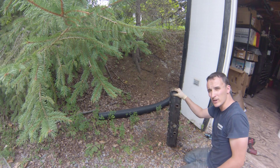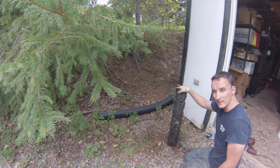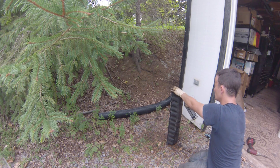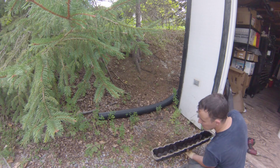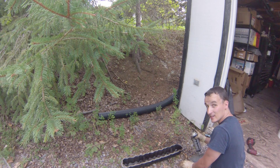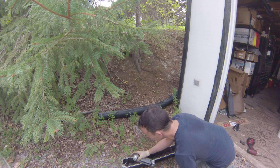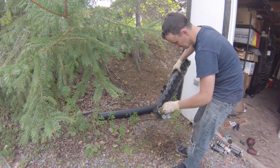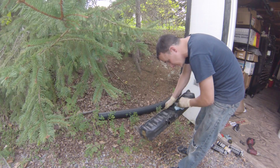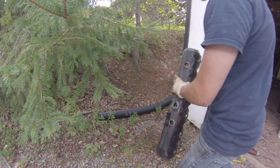Shell's Jeep definitely had some positive crankcase pressure. You can see that the air filter is getting kind of oily — the old one was real bad. These breathers are all clogged up, so I want to make sure I can spray them out real nice. I'm almost tempted to unbolt those breather sections, but I don't want to break one of those bolts on a 20-something-year-old. I'm going to avoid that. Those breathers are still a little gummed up in there, but they're not too bad — definitely a lot better than what they were. We'll give it a little compressed air for good measure.